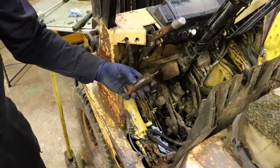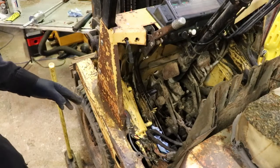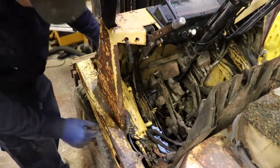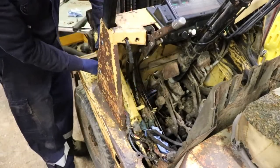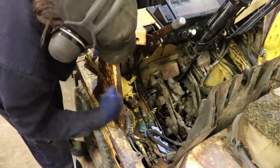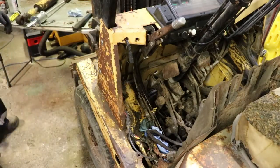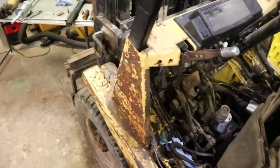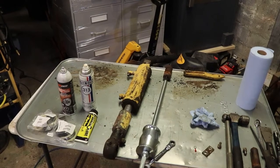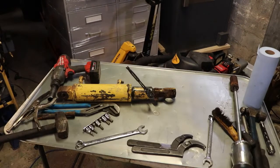Here's the other pin - you can clean that off. It's got a bit of wear on it, but not terrible. Now you might be tempted to squish this cylinder down to get it out - if you do that you're going to have oil flying everywhere, so I would not do that. We're out. I'll just have to run it back and forth to get the oil out into a catch container, then clean it off and start pulling it apart.